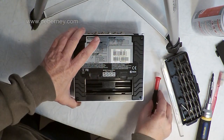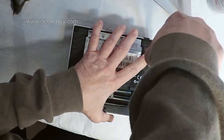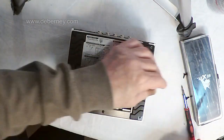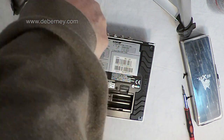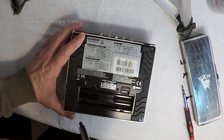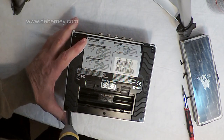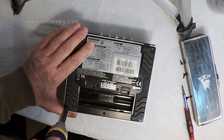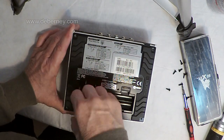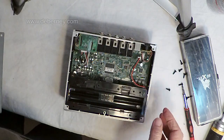Now we're going to take off the back and see if we can clean this all up. You want to be careful not to press too hard and damage the bottom of anything — I have a cushion under this tablecloth. Make sure you don't lose your screws, and if they are different sizes, make sure you know where they go. What I usually do when working on computers is take a picture and put the screws on the picture where they go. Be careful because sometimes these have ground wires attached — this one does not.